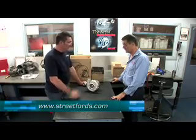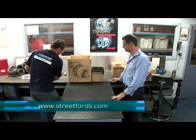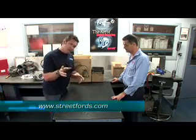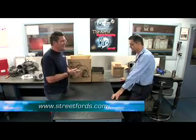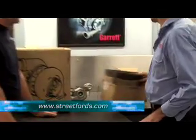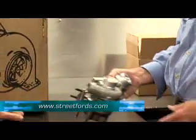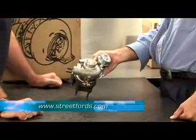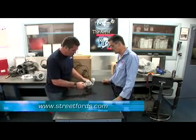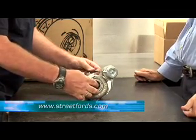You guys build something for everybody. Let's talk the long and the short of turbochargers - what's the smallest turbocharger that Garrett makes? Well, the smallest one we actually stock - not necessarily the smallest Garrett makes worldwide - is this little GT12. What sort of power can something like this sustain? Probably about 100 horsepower on a 500cc engine.